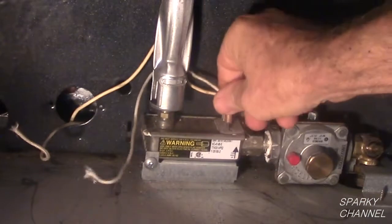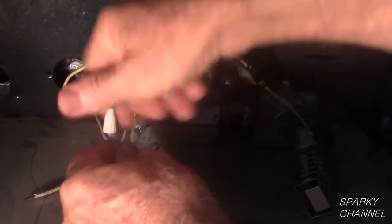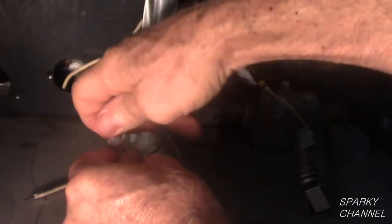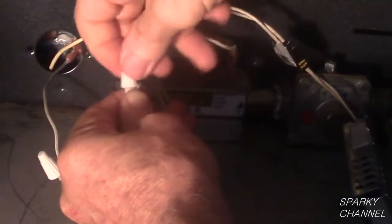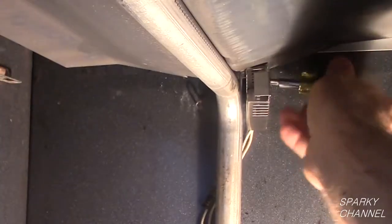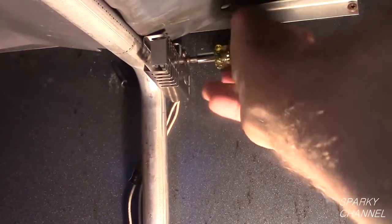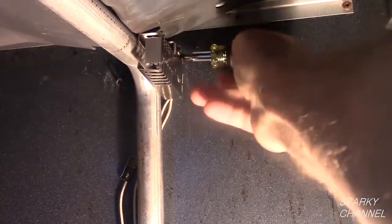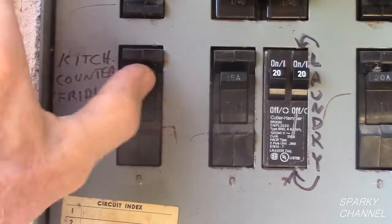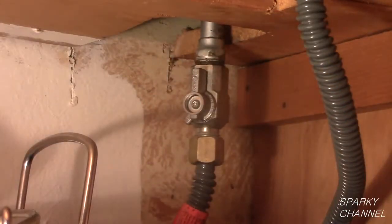Put the terminals back on the safety valve. Hook up the new igniter to the wires with the provided ceramic wire nuts. It is very important that you use ceramic wire nuts and do not use electrical tape in place of them. Now install the new igniter — the Klein Multi Stubby is extremely valuable due to the limited space. Reassemble the oven, turn the circuit breaker back on, and turn the gas to the oven back on.